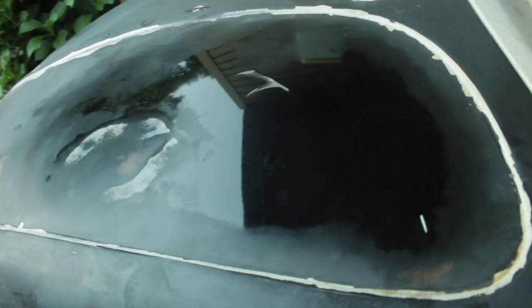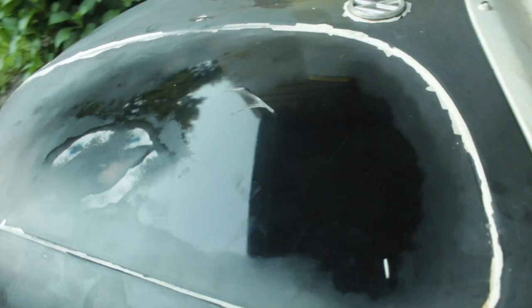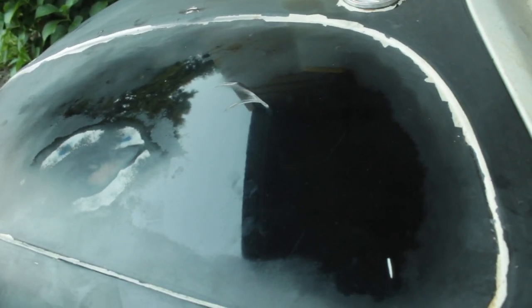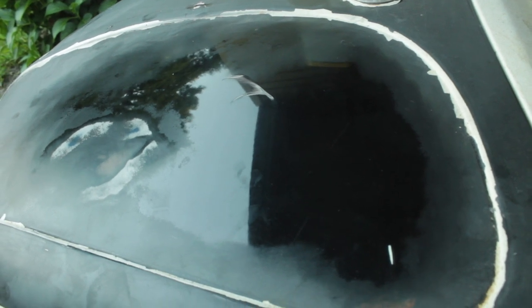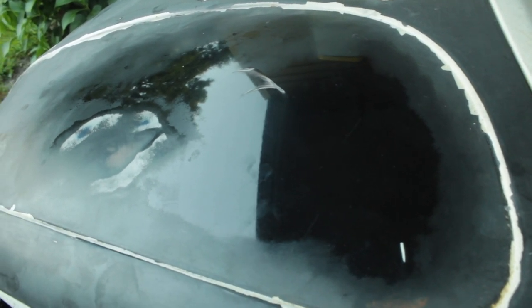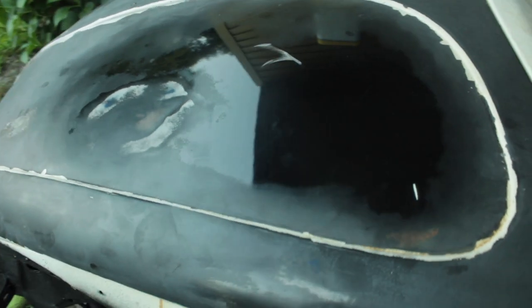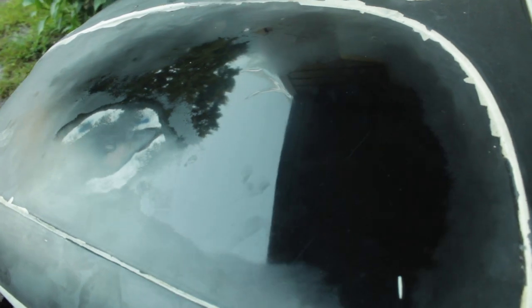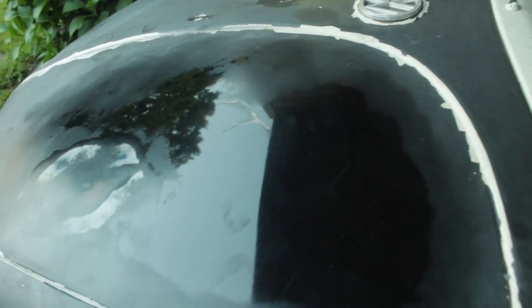Overall, I think this is a great technique for making this original paint shine again. My suggestion is that if you have a car that had a poor repaint done, try a few areas and see how bad the original paint is underneath. If it was sanded heavily, I don't suggest you do this, but if there was light sanding or no sanding at all, I think you should try this in a few areas on the car and see how well it turns out. If my car turns out like this in a few more spots, I might not even repaint the whole thing and just do some blends and touch-ups in other places.